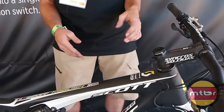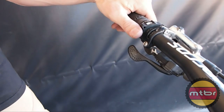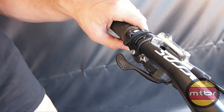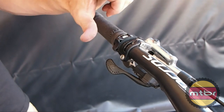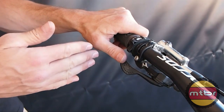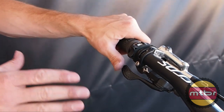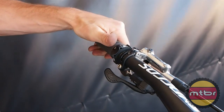It works with very little effort and not a lot of force on the lever. He has it set up in two positions — locked out and unlocked. A nice thing about the system is you're able to adjust it; unlike a normal system, you can program which direction locks it out. You can't do that with mechanical systems and cables. Another big benefit is you can set it up left to right, and it has an extremely low lever force — mechanical systems require quite a bit of force to activate.